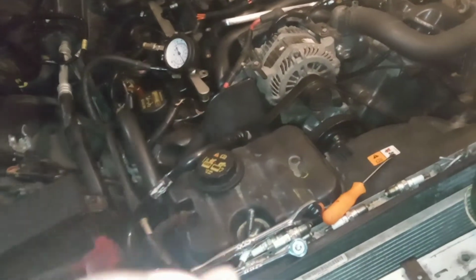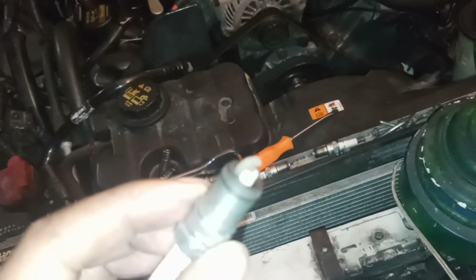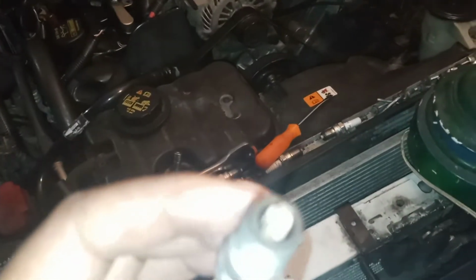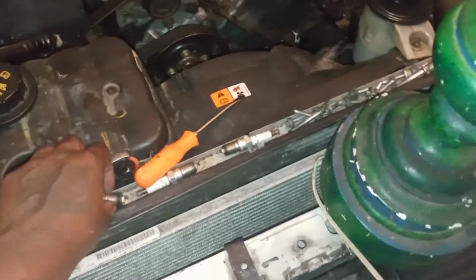Like I stated in the last video, I thought it could have been valves. Maybe it could have been a head gasket leak. Another thing that I'm weirded out about is the spark plugs. They are a little dark. There are flies out here everywhere. I'm going to try to get Ford-only spark plugs. I gave it the benefit of the doubt of being a little dark because it is a fresh rebuilt engine, but it is a little dark for me looking at it now.